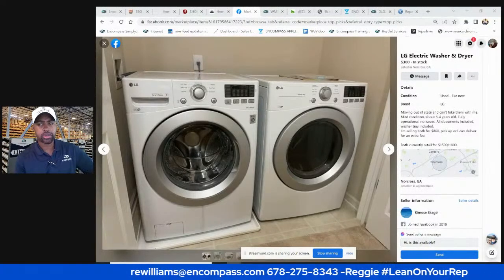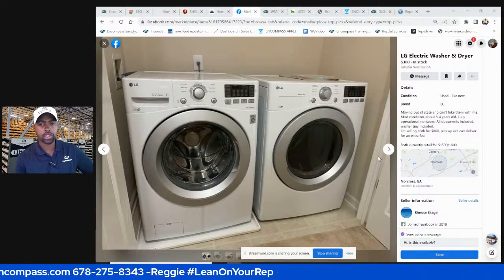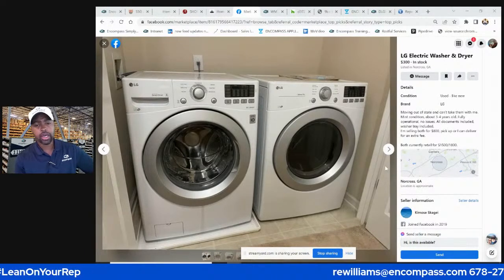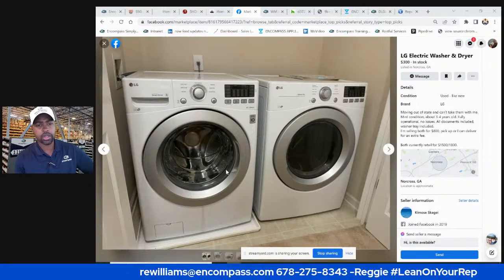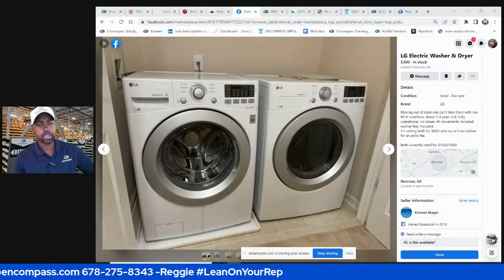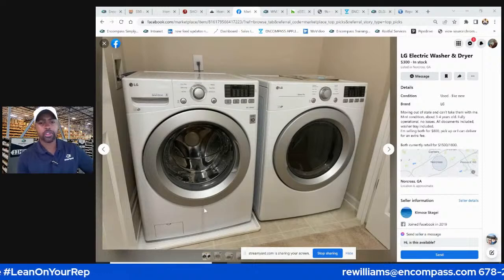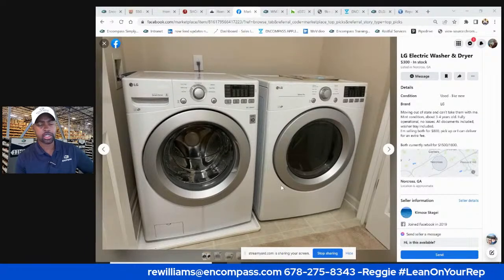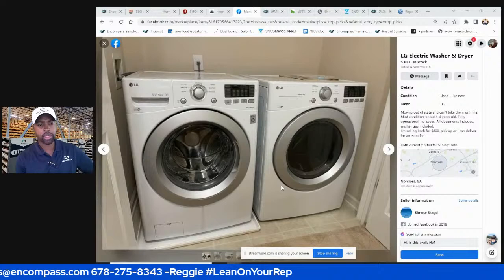So this is good if you are doing COD work. You probably won't see a lot of this under warranty. Maybe home warranties, I don't know. I rarely come across one of these with a bad bearing. That's almost always the first issue with front load washers. I don't care what brand it is. First thing you do, especially if you're doing this for flipping, you spin that tub and see if that thing has a bad bearing. There's going to be some play, right? Because it's on stabilizers.